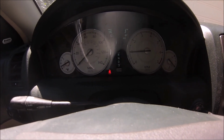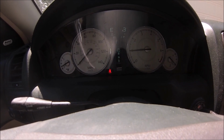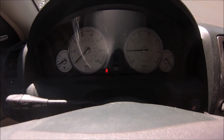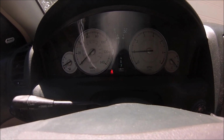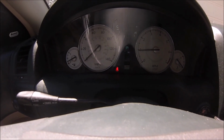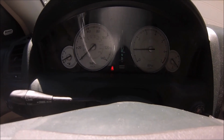I could tell because at a certain pressure I would apply the brakes and the steering wheel would slightly start to shake, which could mean warped rotors, but I know that's not the case. It's just seized caliper guide pins. So on the right side, the passenger side, on the front, I cleaned up the pins, I changed up the boots, all that stuff. All was fine and dandy.